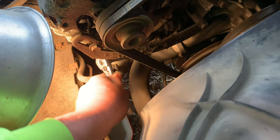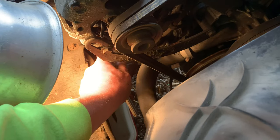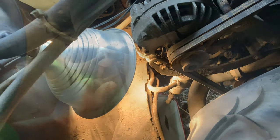Loosen that up. Hard to do one-handed. Don't forget, when installing the new one, you're going to want to use the new clamps that it comes with or get yourself new clamps. New hose — it's the time to do it right now. And they do give you new ones with that. So let me get these other two clamps off there and then we'll pull the old filter out.